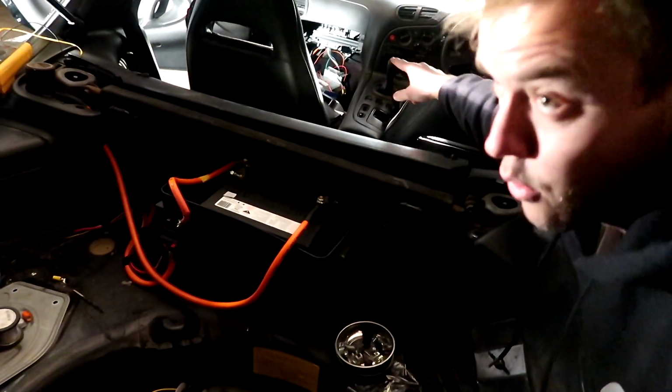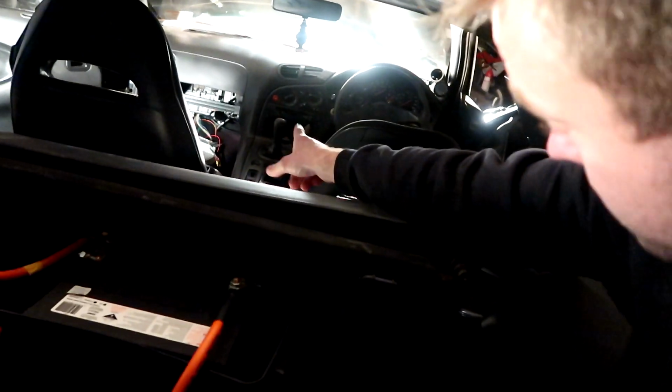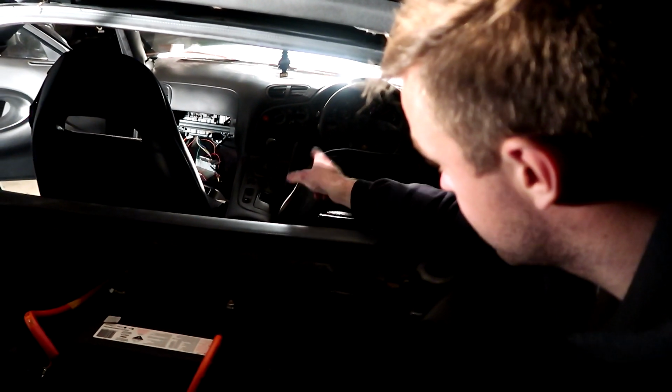So I'll do that when I get more gas for the soldering iron, because I need to do the constant feed for the ECU and stuff. Yep, and the injectors. Then I'll do the wiring for the wideband and the boost gauge. Are you gonna run any other gauges or nah? Just those two. Your fan wiring you need to bring through to the middle, and then we need to run another wire for the high-low boost switch to the excess one.